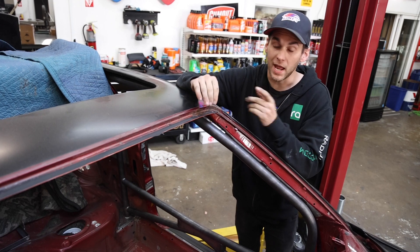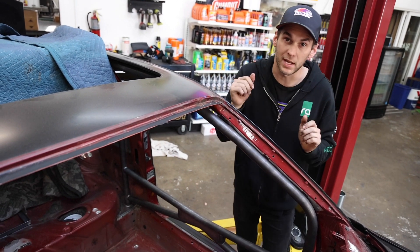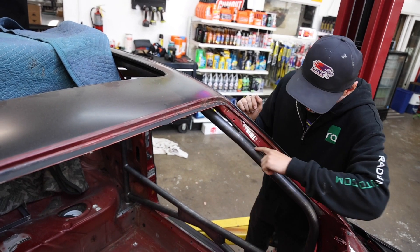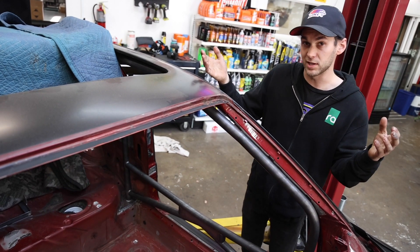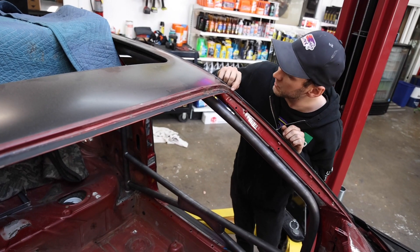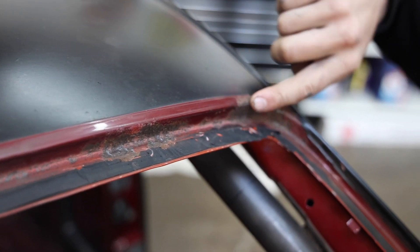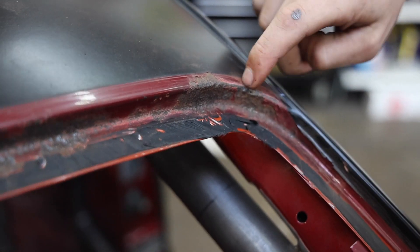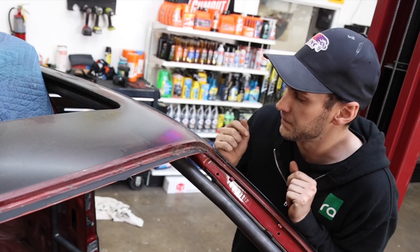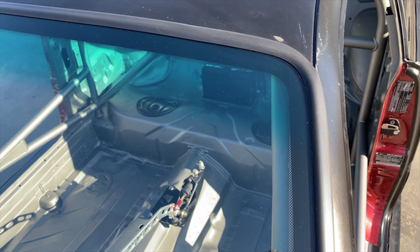I figured I need to yank the windshield out, because I really want to be able to stitch weld this A-pillar on the outside — it looks really cool and it's going to help with strength and rigidity from the cage. Also, with the windshield in, it's going to be very difficult to paint these A-pillars and the whole front side right here, which is really obvious when the car's coming straight at you. I had my buddy Otis come over and he pulled the windshield out, and we found just a little bit of rust right here, right up along this brow area. So I took an angle grinder with a wire wheel and went ahead and wire wheeled some of it out. Otis said this is pretty common with a lot of these older cars — this thing is a '95, so it's got a couple of years on it — but none of it is really too bad.